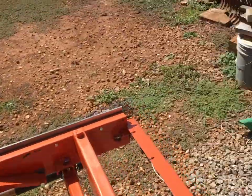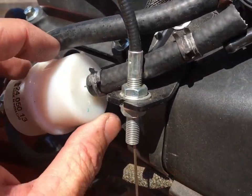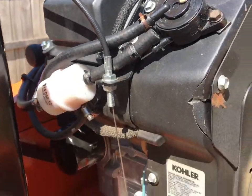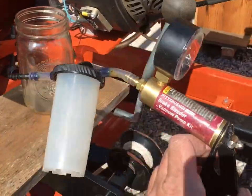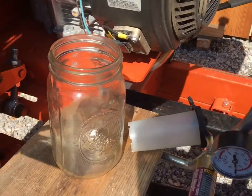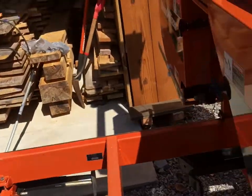Alright guys, so we went and replaced the fuel line. I haven't got it hooked back up yet, but I wanted to show you a couple things. We went ahead and replaced this little section right here as well. I've still got it unhooked because I'm going to use this vacuum pump — for like a brake line — that you can get at Harbor Freight pretty cheap. It'll hook in the line right there and should be able to pull some fuel over here, help fill this fuel filter up, and get all the air out of the line.